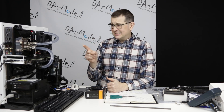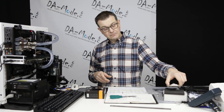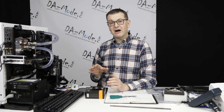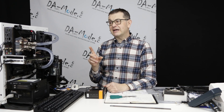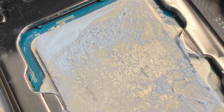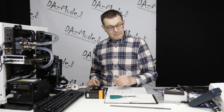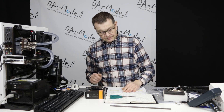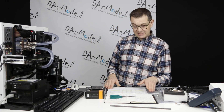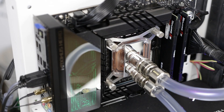They do it in a very sneaky way on this particular motherboard - I was able to mount it 90 degrees and it looked perfectly fine, but it prevented me from tightening everything at the very last fraction of a millimeter. So I got a bad connection, started the PC, and it hit 100 degrees right away. Pay attention to how you mount it - it's important. Luckily I didn't damage anything by mounting it the wrong way and hitting some components on the motherboard itself.